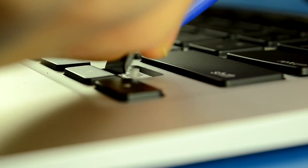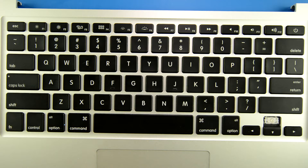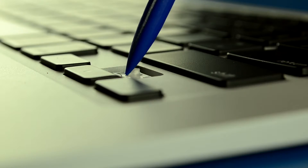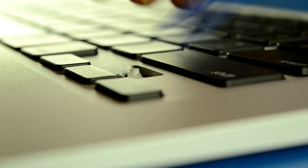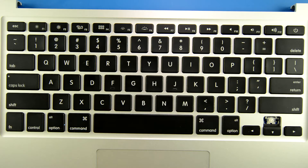Take that arrow key and place it aside. Now to remove the actual plastic hinge, put the tool just above the rubber cup but underneath the plastic hinge, then slowly come back and it shoots up — snaps right out. You can grab that with your fingers.